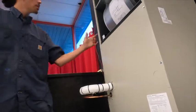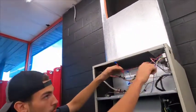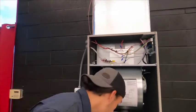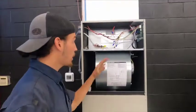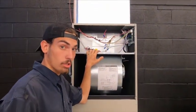The float on this side goes back through here and it's connected to my board. So if there's any water trapped in either one of these float switches, it will raise that float up, cut the power, and not let the unit turn on — making it so there will not be any water damage at all. Thank you.